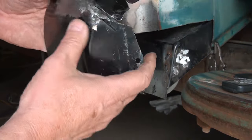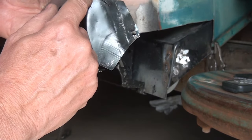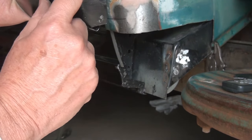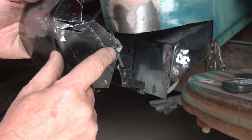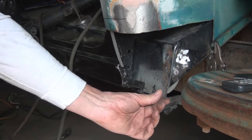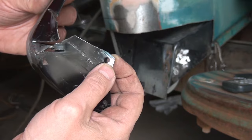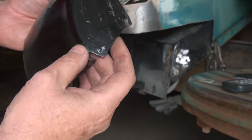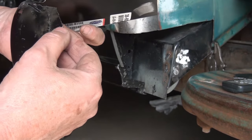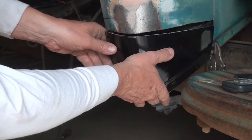So now I have to address my efforts to what's going on down here, which is a complete mess. The bottom line on this is, this right here was where they had put the brake in for this flange that is supposed to weld to this flange right here. And I flattened it out completely. I've cut just the very tip of it off, and it just barely touches when this is in the right place. So I'm going to have to figure out how I'm going to get a flange on this so that when it's in here like this,